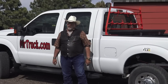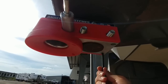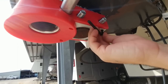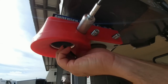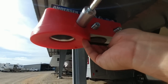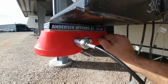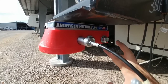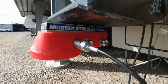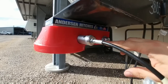The coupler attachment has been placed on the kingpin. A pro tip: the grease on your factory kingpin when you switch to this may prevent it from sliding on well, so you might want to take a pocket knife and scrape it off like I had to. I've inserted the two bolts essentially holding the piece onto the kingpin itself. The instructions say to use a quarter-inch Allen head key to tighten down the set screws underneath here, torqued to 40 pounds. But since I can't accurately torque that down, what Anderson told me is to use the Allen head key, get them as tight as you can by hand, then do one additional quarter turn, and that should be fine. The nuts on these bolts just need to be tightened snug — their purpose isn't to add squeezing pressure, they're designed to hold the adapter onto the kingpin by creating a bracket it sits on top of.